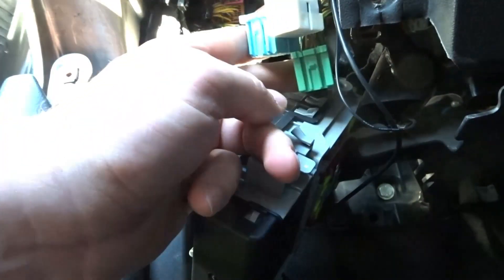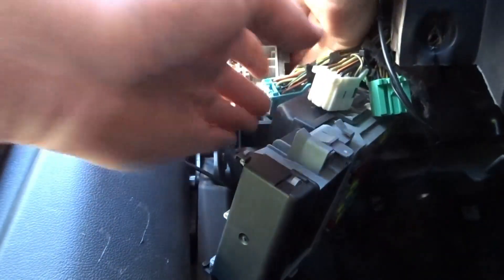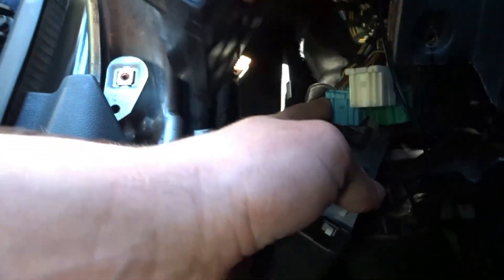Actually there are seven connectors total. These next ones are more challenging — I use a plastic screwdriver because the wires are on the side of the tab. You can go in on the inside, push the tab with a little screwdriver, or if you have small fingers you may be able to do it. Unplug those, then with all connectors removed, press the two tabs and the BCM should slide right out. Now we'll go to the computer.